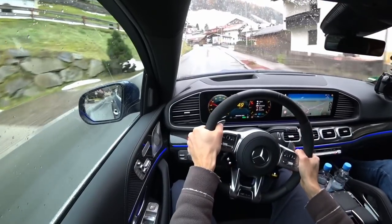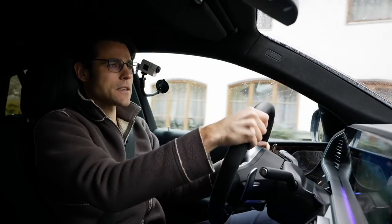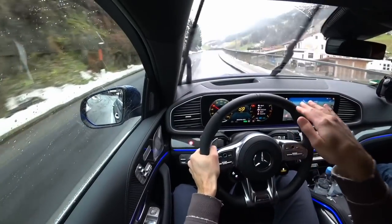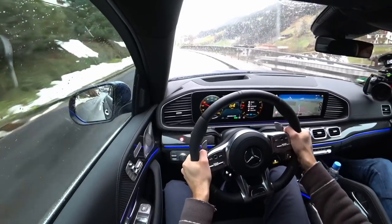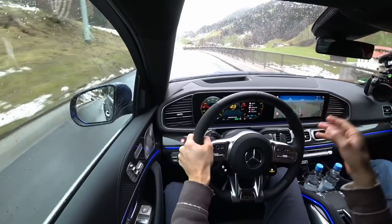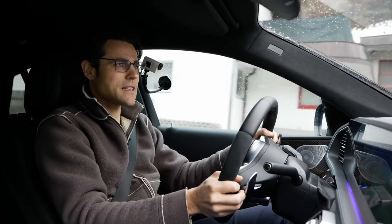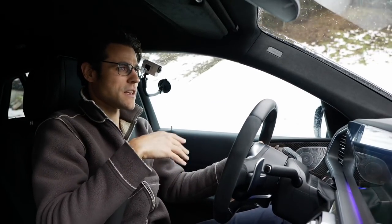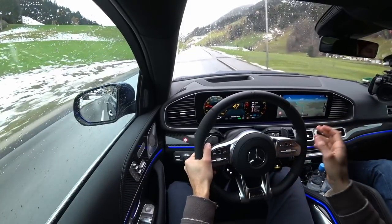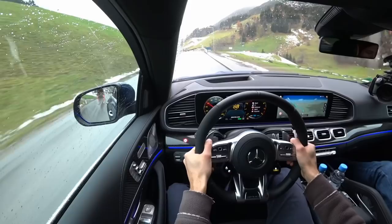The GLE Coupe does not offer rear axle steering. It does offer the special E-Active Body Control where the car can lean inside the corner, but for AMG models they exclusively have the AMG roll stabilization so the car keeps more upright on the road. No matter what I do with the car, it does not have the typical SUV rolling effect. The AMG version also sits a little bit lower, with a stiffer air suspension and anti-roll stabilization — that makes the typical soft air carpet ride feeling just diminish. Really refined engine, definitely.